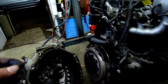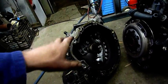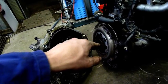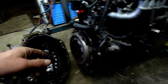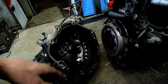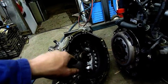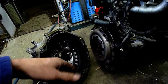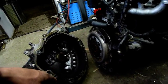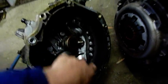I'll strip this off and give you a look at it before I put this on the engine stand. The clutch is the crucial link between the engine and the transmission. Autos, of course, have a torque converter — a fluid dynamic converter. But for manuals, it's dependent on that — that's your link. If it's stuck engaged, you won't even be able to start the engine. If the clutch is blown, your flywheel and everything will be spinning, but there's no friction between the flywheel assembly and transmission to deliver torque and power. You'll sit there revving and won't go anywhere, or you might go at running pace at the most — redlining the engine and barely driving along. That's because your clutch is probably blown or the bearing has self-destructed.